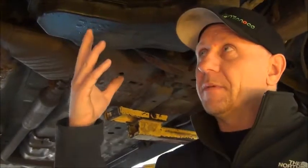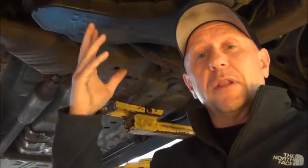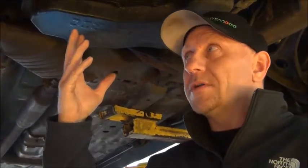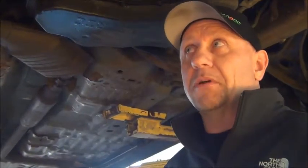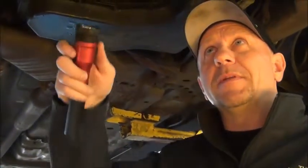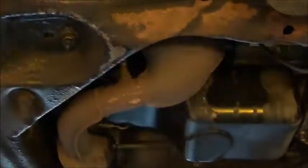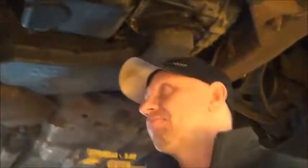In this case, we have two situations going on. Number one, the fluid level of the oil is a little bit low — about one quart between oil changes — so it's losing enough oil to be a quart low, which is quite a bit. And number two, it's actually getting onto a motor mount up in the front here. Motor mounts get rotted out from oil, so we want to make sure we get that remedied as well.